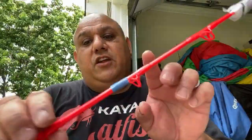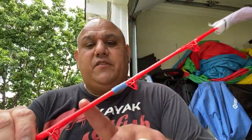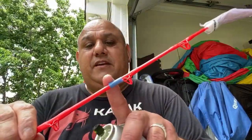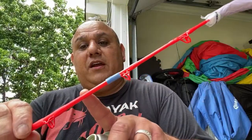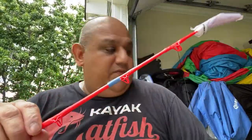And then once I do that, I have to prime it again white and then start working on the yellow. So it takes two coats of primer to cover this, which already has two coats of primer before I even put the pink. So it takes two coats of primer, then your pink, then you clear it, then you let it dry overnight, then you mask it off, then you prime before you start doing the yellow, because the yellow will never cover the pink. I know some of y'all are asking questions, but I'm just rambling on anyways.